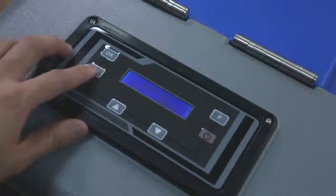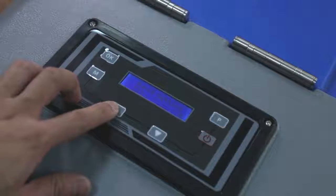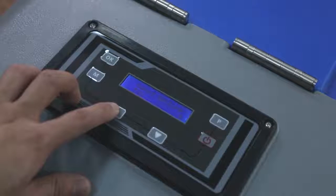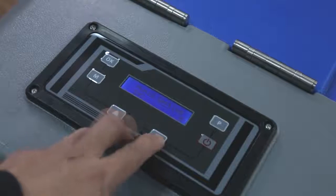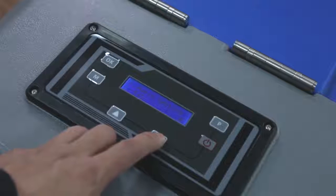The control panel is right here on the front. Just press the button and set your desired humidity level. We set it at 50 percent humidity when production is finished. You can set it between 35 percent and 90 percent relative humidity by adjusting the up and down buttons if your space starts to feel too dry or not dry enough.